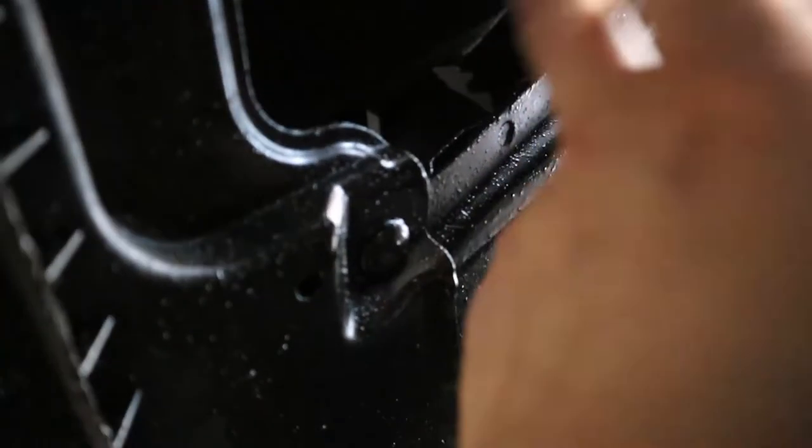This is what I'm seeing. See how it's just wet right there? It's just wet all under there. You can see right there is a little drip coming down. So hopefully it's the oil filter gasket that's coming off this and getting all this moisture down here. Because this is the only place I'm really seeing the moisture that is making this drip. Just little by little, just got to work out the problems and we'll find the solutions.